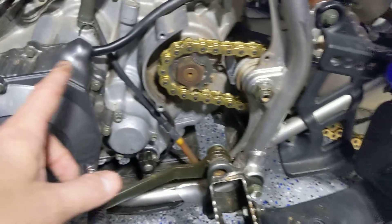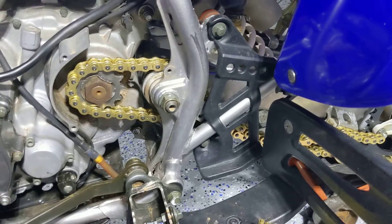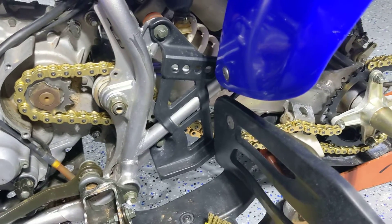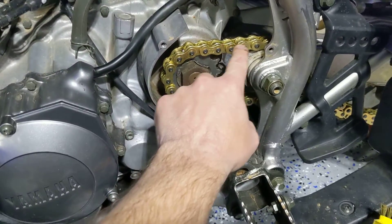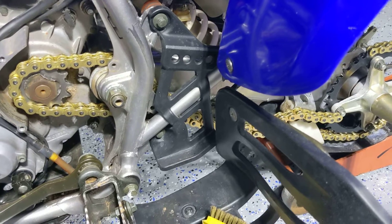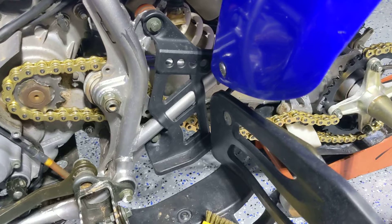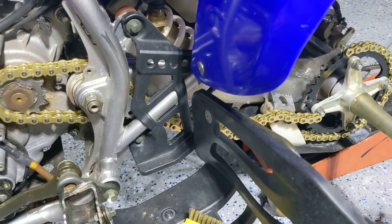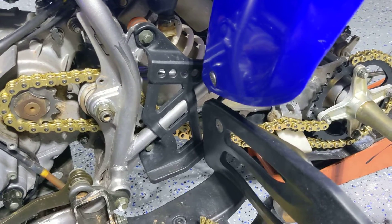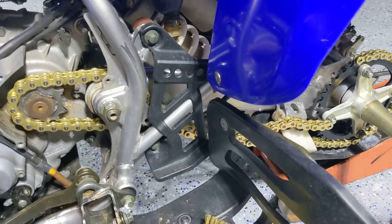When I got the kit, you can get a generic chain — it's a 520 width chain, and the stock chain is 98 links long. That's just how many links lengthwise. You can run up to a local store and get a 520 width chain with 110 or 120 links and use a chain break, which isn't that hard. But you can order the kit from Rocky Mountain and have it in two days with the exact number of links you need — no having to cut the chain, nothing. Just put it on. I ordered it Friday and it's Monday now and I've got it.